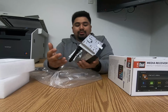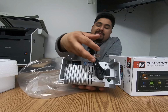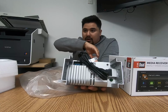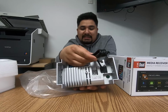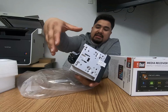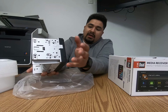And then just like the previous generation, you have your power plug, your secondary plug that we talked about. You have a USB cable that cannot be removed. So if you're going to install this, I recommend a USB adapter, so something that you can mount in the car somewhere and plug into here, or if not, you just have to run this wire somewhere you have access to it. And then again, a full double DIN size, but it's a shorter chassis, so it's easier to hide wires back here when you're installing. But the traditional mounting mechanisms of the radio work.